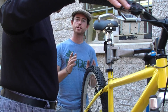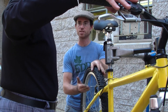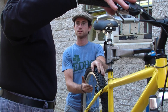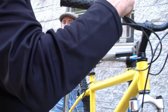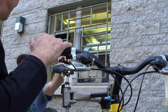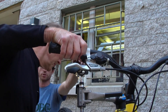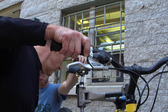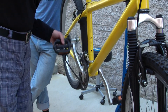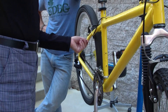Now that we know that, think about how a derailleur works — you've got a cable, you've got a spring. If it won't shift up, the cable is not tightened. The obvious thing to me is this seems to reach the end of its range here. Try and go to the other extreme range. Just go all the way — shift a whole bunch of times until it won't click anymore. Now check out the cable. Problem identified.